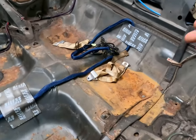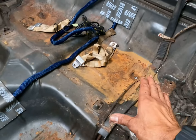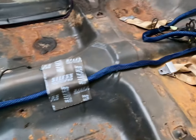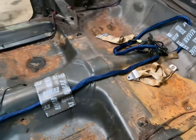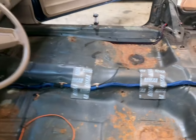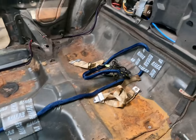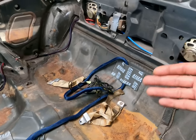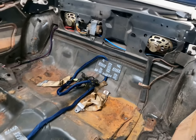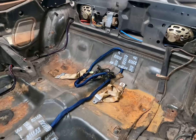This puts the icing on the cake. You see the rust — that's where moisture and water got in, that's where it settled. You see where I ran these wires? You don't see any rust. RCAs are going to be more susceptible to oxidation, and speaker wires getting oxidized and all that good stuff. When stuff gets oxidized, you're going to end up losing connection. The speaker's not going to work because it's a positive and negative on that. You're going to be scratching your head, thinking it's RCAs, and start changing stuff. We don't want to break it down like that.